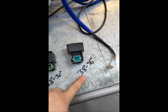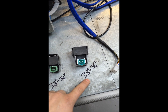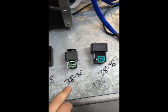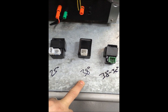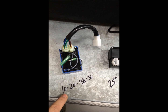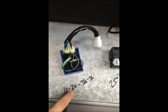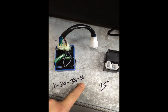We've actually written down here what the CDIs are doing and their advance range. The first one ramps, staying at 38, backing itself off to 36 at full revs. Same with the C90 one. This one's stuck just at 38, this one's stuck at 25. Ours ramps from 10 — you can't quite see because it spins up a little bit too quick to start — then 20 and 38, backing off to 36 at full revs.